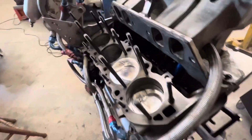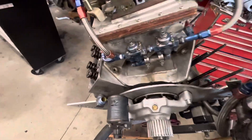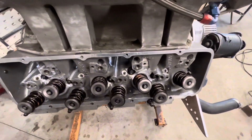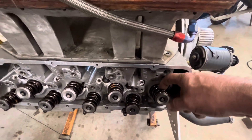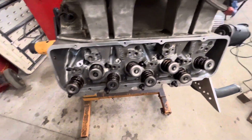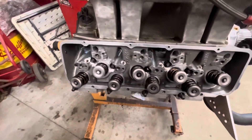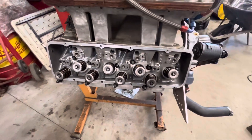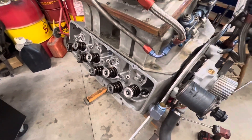This line plumbs right there — full oil pressure. I took the restrictors out; they used to go right here in the block and restricted oil flow to the lifters, which in turn restricted the amount of oil going up the push rods. Now there's no oil restriction — full oil pressure to the lifters, full oil pressure up the push rods. I have the TND rockers where the oil goes through the middle of the rocker arm and shoots out right on the side of the valve springs, so it cools and lubricates them.